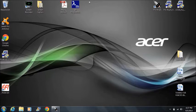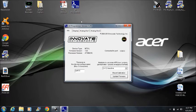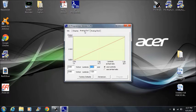If you're using widebands, you'll need to set up the parameters in the wideband O2 sensor controllers. This part is done in the wideband controllers themselves and not in the Pro-M EFI processor. The parameters in the processor have already been set up for you. To do this, load the software on your laptop. You'll get a CD with each of the widebands, but obviously you'll only need one of them to install the software to your laptop. You do, however, need to remember to set up both wideband controllers.